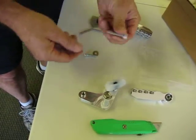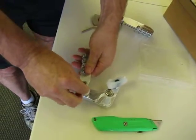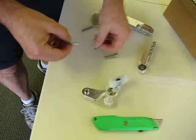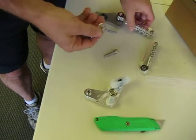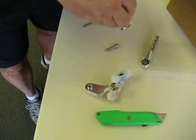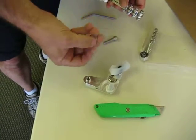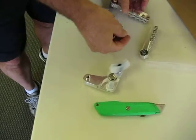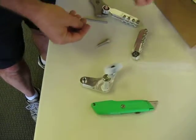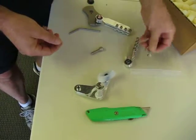You get your Allen screw and that goes right here for attaching the cable end. And then this is a spreader screw and a spreader washer for the cable ends, if you ever need to spread out the gap. We go ahead and give you the tools that you need to do that — to open up the gap to take the cable end off of the shift cable. It's just nice to have these in case you need them.